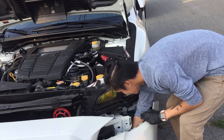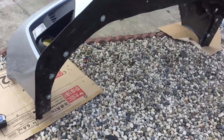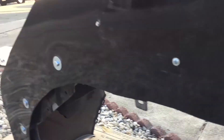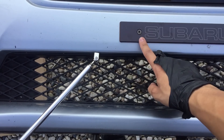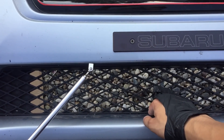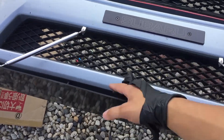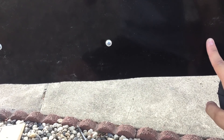He's done. I've been done — I just needed to add a little bit more. For me, I did four hex bolts on each side, then put a PVC pipe to use as a spacer, and washers. Instead of putting it directly under the license plate delete bolt, I put it two inches out to gain more stability. I still need self-tapping screws in the middle — I couldn't put a hex bolt because it's going to go through the lip, so I decided to self-tap it. I still need one more to keep it more stable.